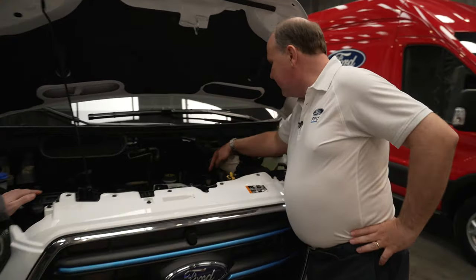A lesser-known fact of the EV world is that a much more efficient way to achieve driver comfort on a cold day is using heated seats rather than heating all the air. Heating the entire cabin of a large van with no bulkhead is a lot of cubic metres of air to warm. Similarly, a quick-clear electric heated windscreen is a much more efficient way to demist than blowing large quantities of warm air.